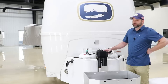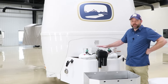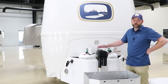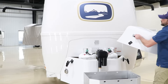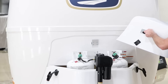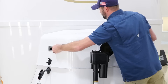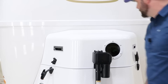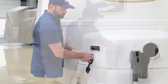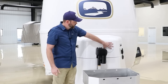Once you come out and it's red, you're already out of propane. We do have an upgrade option — LP tank sensors mounted to the bottom that gauge the weight of the tank and report to your cell phone via Bluetooth so you can see as it's depleted. When setting the cover back on, you'll notice the bracket mounting at the rear on the body of the camper. Slide the LP cover in and make sure it sets properly on that bracket, then place the latches back. Be careful with the deck ports — if you get in a hurry you can cross-thread, so just a little bit of patience.